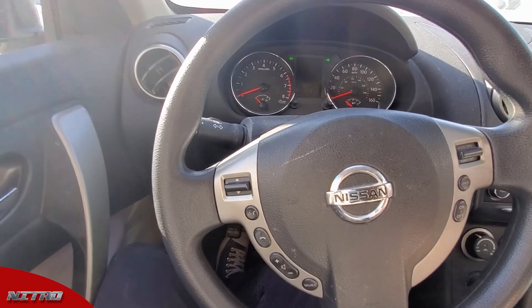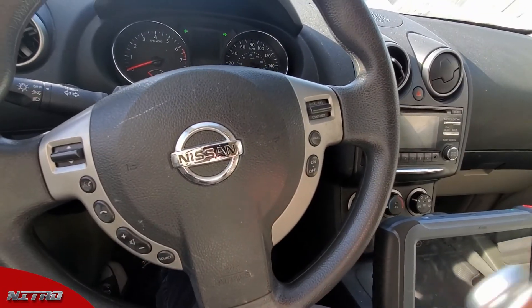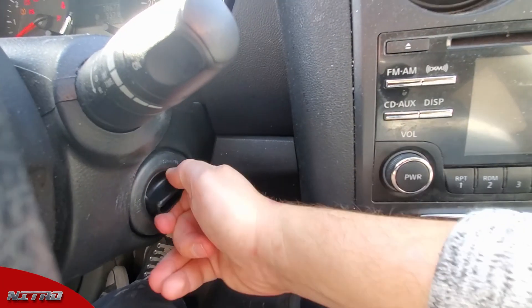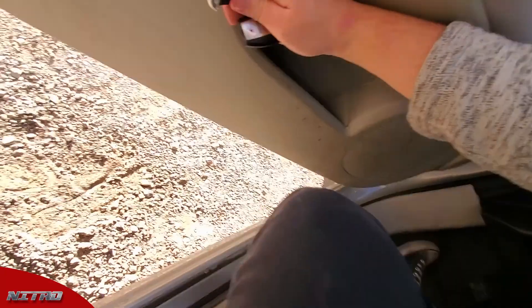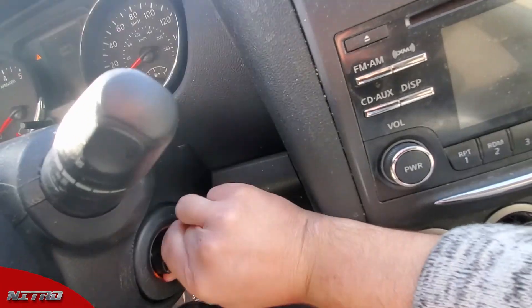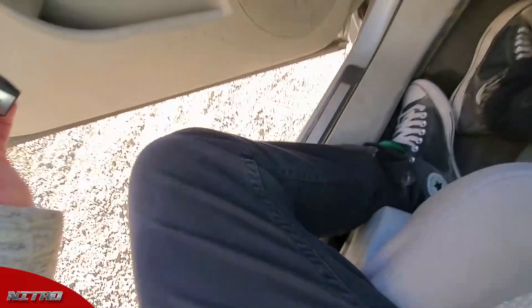Lock and unlock work, panic works. Now I took the emergency key out — to test the proximity portion, this knob should now turn without any key inside the slot. I'm going to push it in and turn it, and the car starts. If our key is outside of the vehicle that knob is no longer going to turn. I'm going to drop this key outside of the vehicle and try to turn it — and nothing. Our key is programmed successfully — emergency key and smart key — in and out, five minutes. Thank you guys.